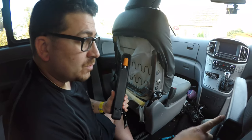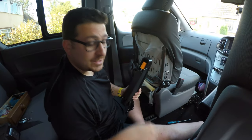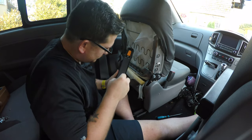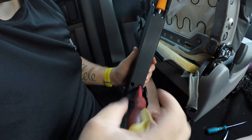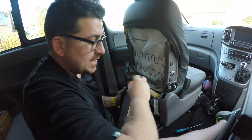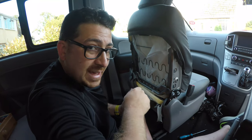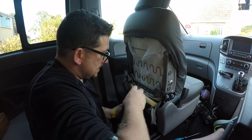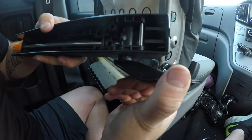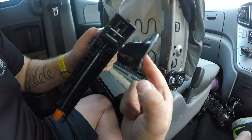Now the easiest way that I found with the driver's side was to dismantle the armrest itself. It's only a cheap armrest off Amazon, and I'll leave a link in the description for it. All I did was unscrew these screws to get inside. It's a lot easier to fit the mechanism from the inside first, and then relocate everything afterwards while it's in situ. As you can see in there, we've got the bolt, that's the stopper, on the stopper bar. So I want this out of there, so I can fit that and then replace it all later on.